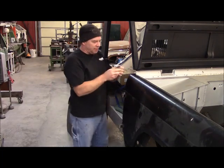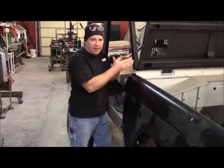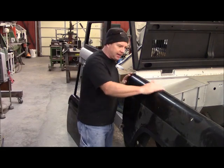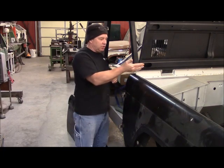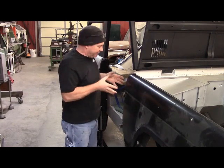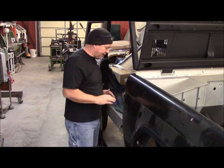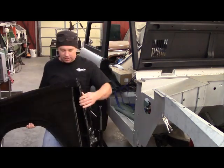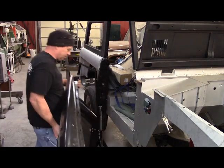So what I'm going to do now is trim this piece — they have it a little oversized. Trimming that out is going to allow me to start raising this fender up. I've dropped my hood down and it's at the bottom of its adjustment, just barely coming down to the proper height. I'd like to move this up anyway, which will give me a little adjustment in my hood and make this fit better. Having that post already in the fender, I'll eventually weld it in place — it allows me to take this on and off as a unit, so I can go back and forth several times.